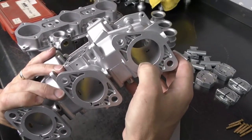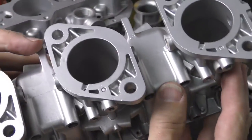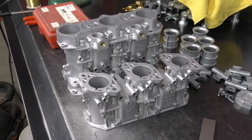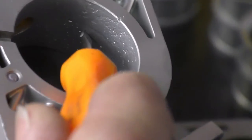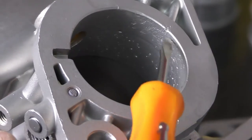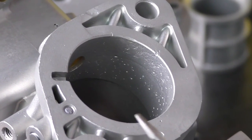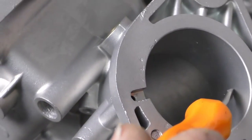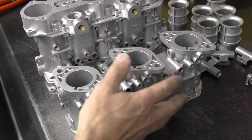When it comes down to the bodies, we want a good look at the throttle bores. We're looking for any signs of excessive corrosion or wear from the throttle plates — if there's a lot of wear, that needs to be corrected by overboring to an oversized throttle plate and making a custom throttle plate. This IDA body has a lot of wear — we can see where the throttle plate has worn into the actual body, and there's corrosion around this area. This happens because the throttle shaft bounces at idle when the bushings wear out. To correct this, it needs to be overbored and a custom throttle plate made.